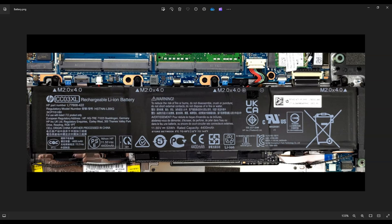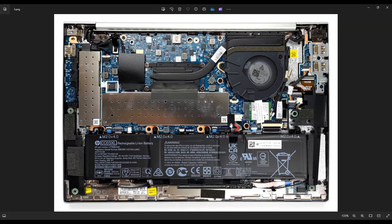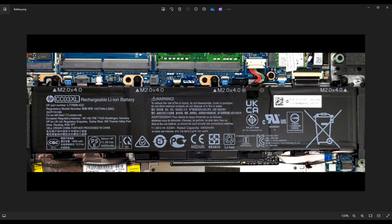After that, this is your battery plug right there. Some of you may have a black piece of tape over it. As seen here when the computer was first opened, you may have to take that black piece of tape and just bend it back a little bit. After that tape is removed, you can unplug this. Now as with any wires in a computer, try not to pull on the wires. Put your fingernails on either grip on that plug, or use a pry tool or a pair of pliers, and you can just jimmy that plug right out of that port.